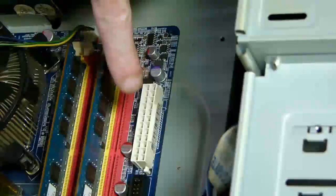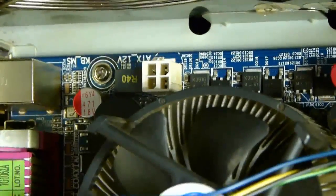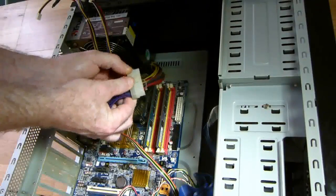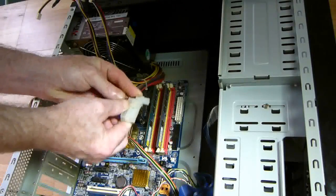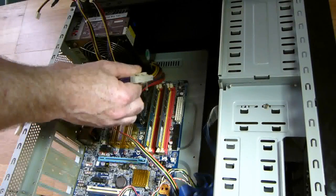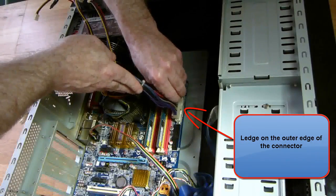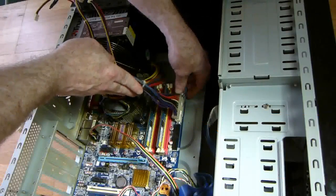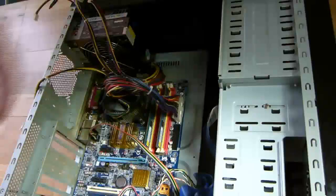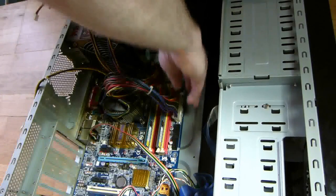Here is the 24-pin connector and the 4-pin connector for the CPU power. Take the 24-pin connector and make sure it's fully assembled for your ATX motherboard. If it is a smaller form factor, you will only be installing the 20-pin connector — again, check your manual. Line up the clip with the ledge that holds it in place, then put your fingers underneath the motherboard to prevent it from bending too much when you apply pressure to push the connector into place, as it is possible to damage the motherboard. Make sure you are applying upward pressure with your fingers while pushing down with your thumbs.